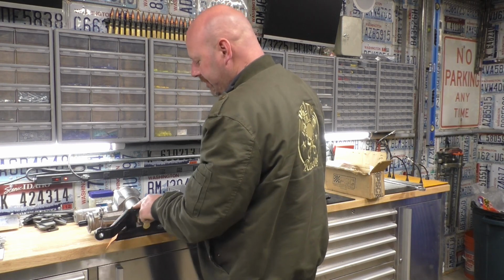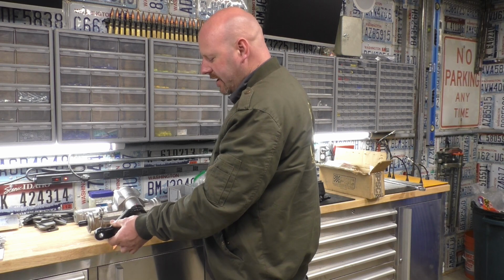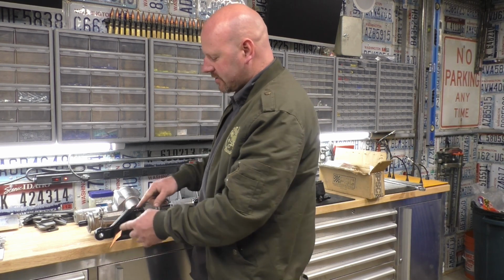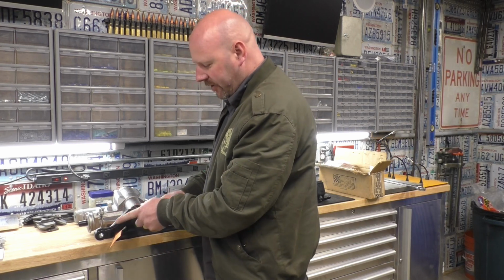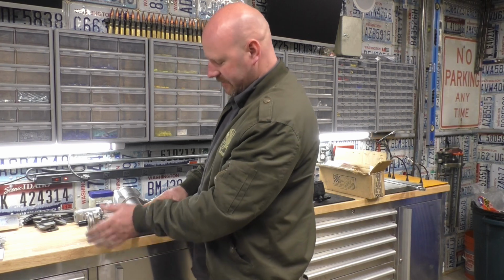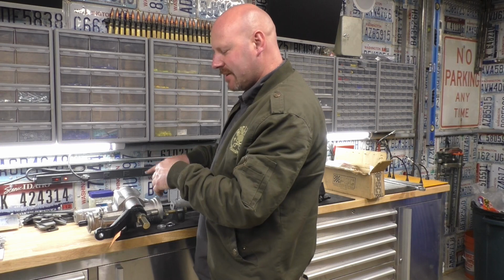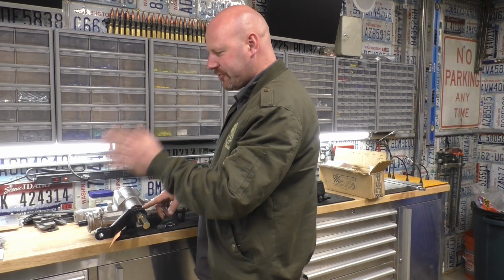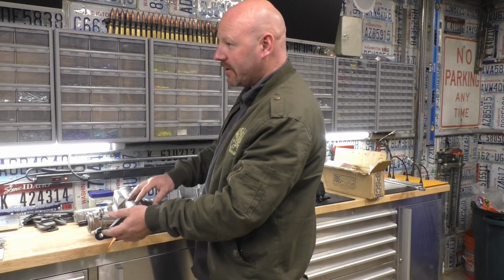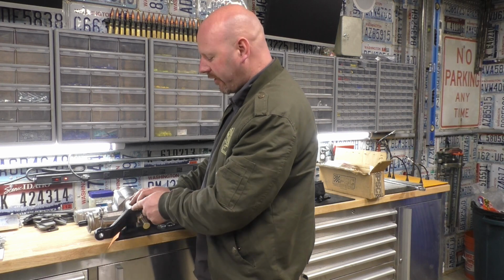This is an arm off of a 99 Grand Cherokee, if they were to lift one. It's the same offset as an XJ arm, even though it's a lifted arm, but it's longer. So it gives us more throw, because I don't think our stock arm gets full steering, even though I measured it and it seemed like it would work. In fact, I know it doesn't actually get full steering. So that's why I did some research and found that this is a longer arm.